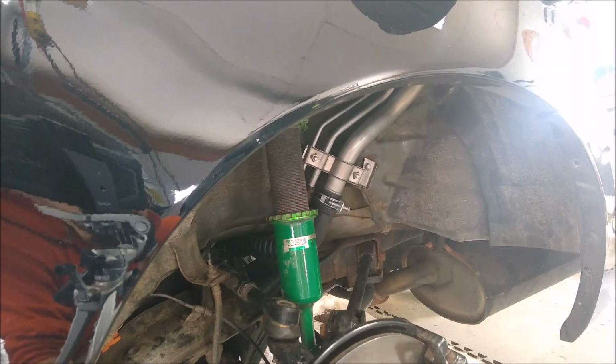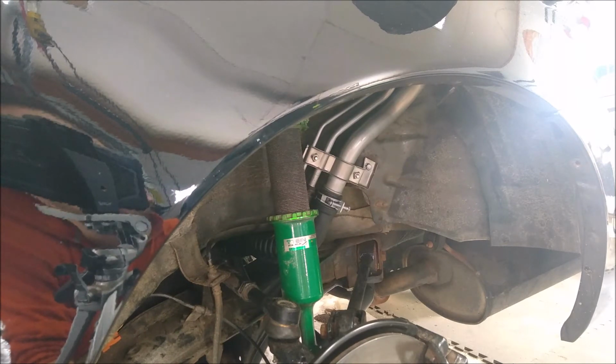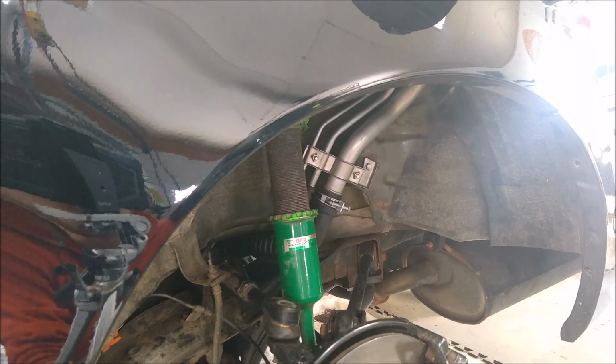Likewise, one of the clamps on the inside of the gas hose there going into the gas tank itself was positioned awkwardly from the factory. I can only assume that it's OEM original, but it was faced in such a way that I couldn't really get a wrench in there. So I've repositioned that with the install so that it faces down, and you can actually snake a 10 millimeter socket wrench extension up there, or use a screwdriver.